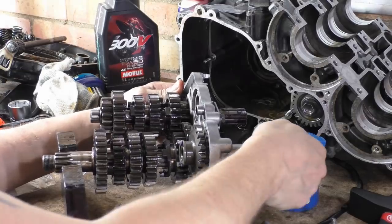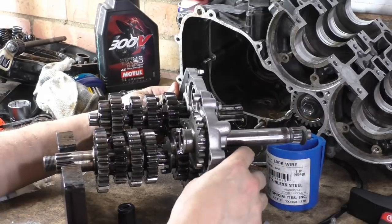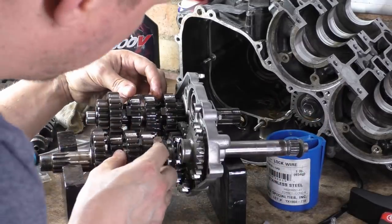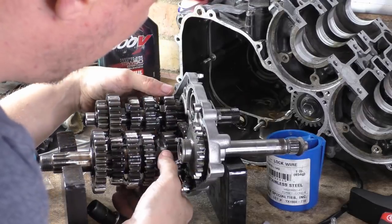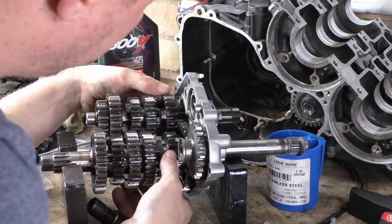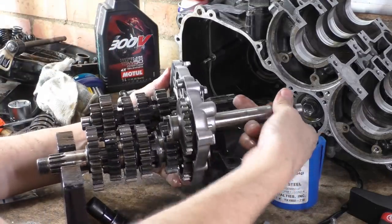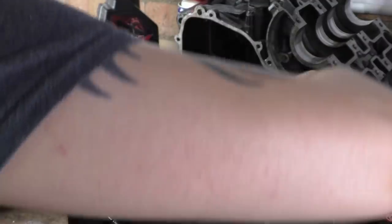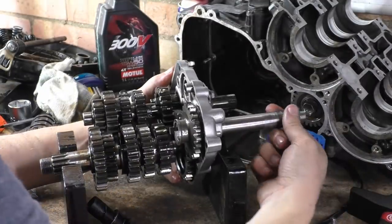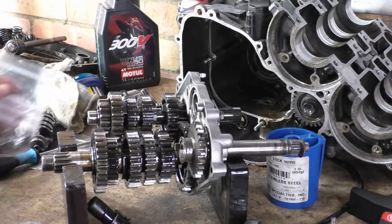Turn it, he says. What's locking up? Something's locking up. Right there. Not split. First gear. So, you can turn it, and then it ratchets. Turn, then it stops. It stops solid, then you let it go. That's it ratcheting back, so there's a sprag clutch in there.